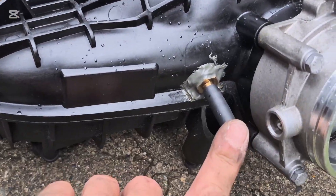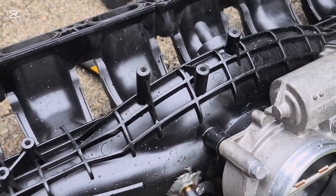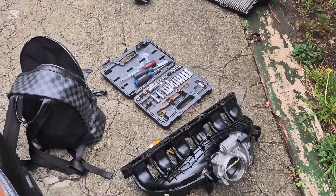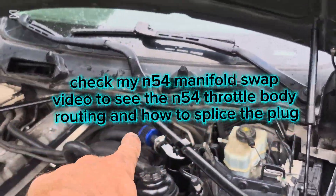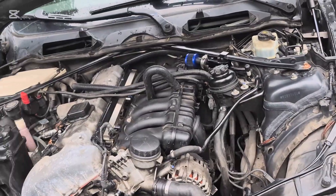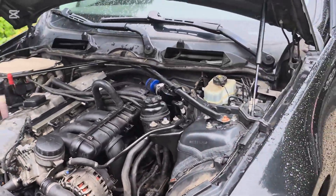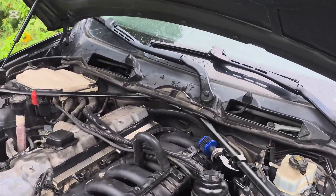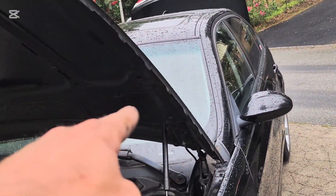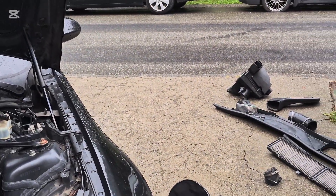Or you can tap some fittings if you want, but I don't recommend doing this because you're just creating more spots for vacuum leaks. So that's the manifold that I bought — somebody did that, I don't like that they did that — but I'm going to be getting an N54 throttle body and doing it that way. Until then I'm venting to atmosphere. As long as you are venting somewhere you will not have any leaks creating. It is when you cap that off that you would then start getting leaks. So as long as your crankcase is venting pressure somewhere you will be good. I see lots of track setups venting to atmosphere and they are just fine. The only downside is you will smell a bit of the crankcase gases inside when you have the AC on.